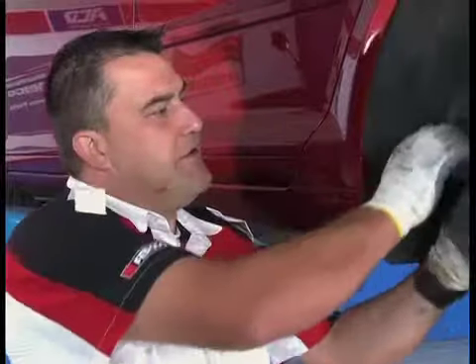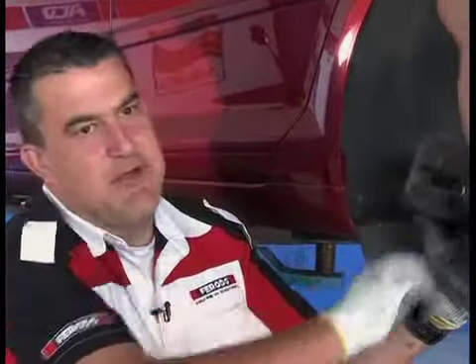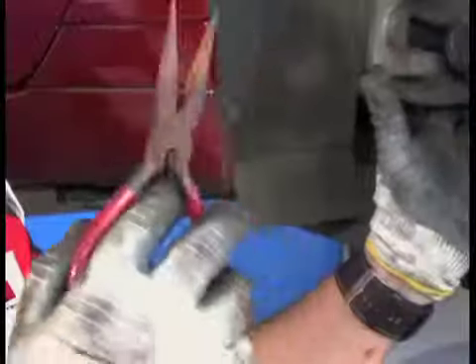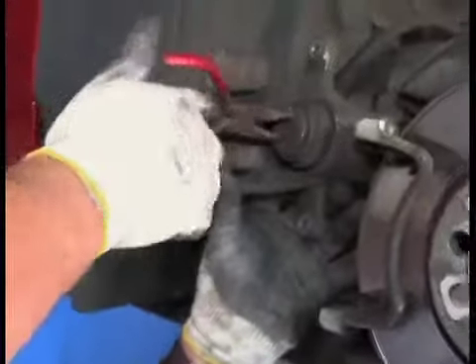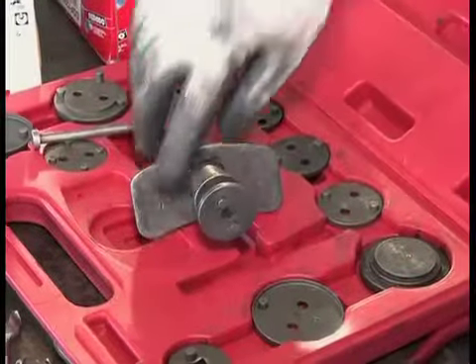Even just a little bit of wear and tear — safety first. Something I want to show the viewers at home on the rear brake system is how to get this piston back safely. Over the years I've seen guys use long-nose pliers to try to turn the piston and push it back, and it normally ends up with somebody's hand needing a couple of stitches. So you need a specialized tool, and I've brought one with me today so you can actually see what it looks like.